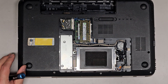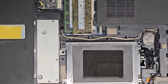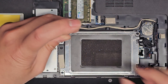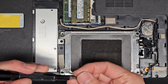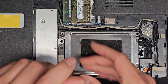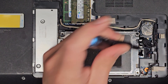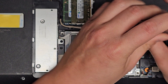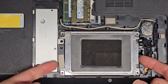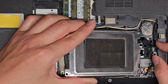We've already cloned everything over. Technically you don't need to have the battery out to work on or replace the hard drive or the RAM, but in this case to remove the bottom cover you have to take it out anyway. There are four screws holding the hard drive in place, and then four more screws holding the hard drive into the caddy, so we'll remove those to put the SSD in its place. Be careful because it is attached with a little cable here — after you get the screws out, carefully lift it up and watch out for the cable.